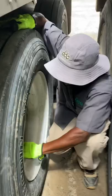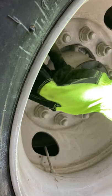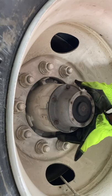My valve cap and stem is not missing, damaged, or broken. And if I want to check my tire inflation, I'd do it by using a proper tire gauge. My rim is not damaged or bent, shouldn't have any welding repairs. And there's no rust trail to indicate that my rim is loose from the wheel. My lug nuts are all present, not loose.